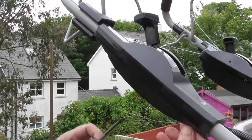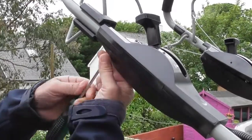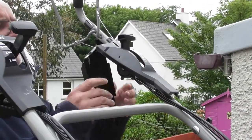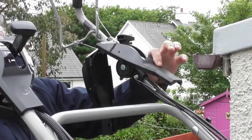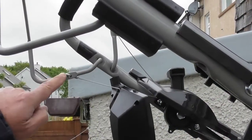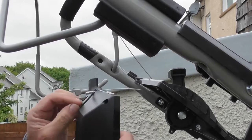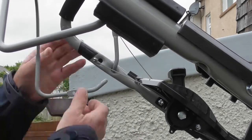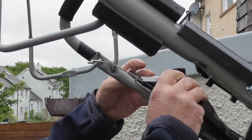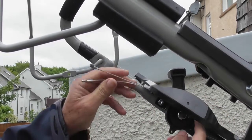The long screws pass through the grey handle, while the short ones just go from one half of the plastic casing into the other half. Having undone all the screws I'll pull the bottom casing out of the way — the top casing is loose as well, but they won't physically come off just yet. I need to release the ends of the cables from the handles. If I pop the handle out of its location that gives me enough slack to release the cable and also release the plastic cover.